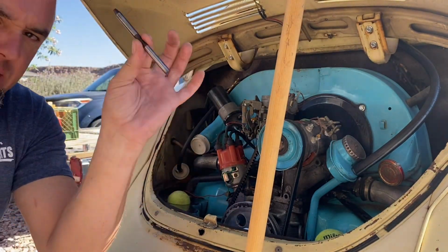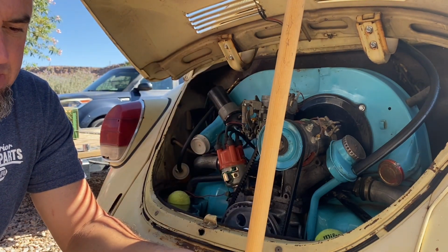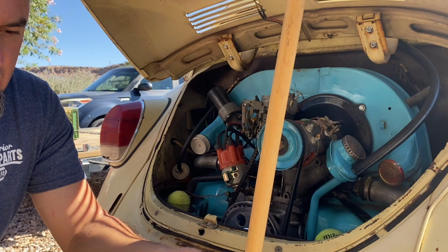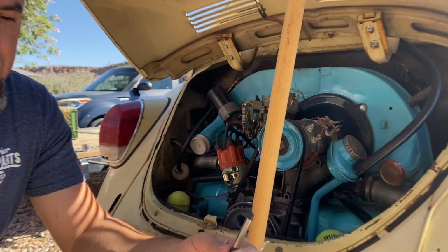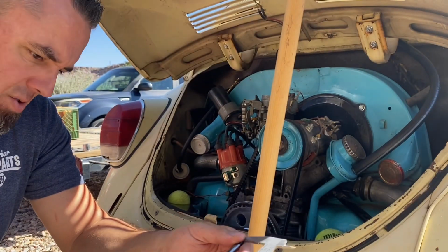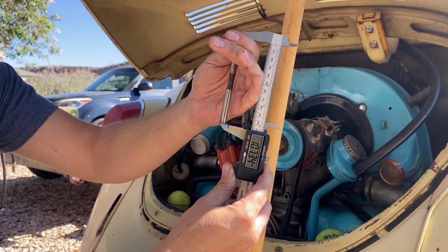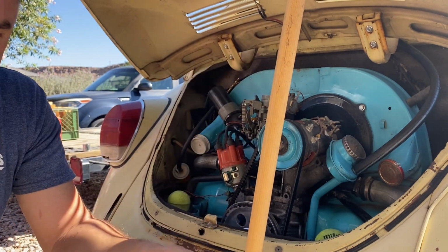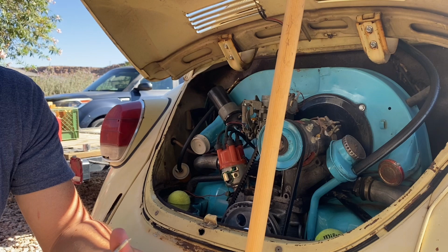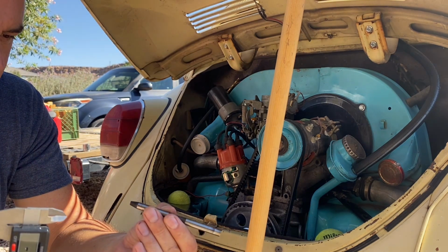So Ozzy said this push shaft for the pump, for my style of pump, should be 108 millimeters. So we're gonna take this dial caliper out to 107.34. So there you have it. See if it's cockeyed at all. Nope, dead center. 107.34. So it's probably a 108 millimeter shaft. Just under a millimeter short, so we'll call them and find out what we need to do.